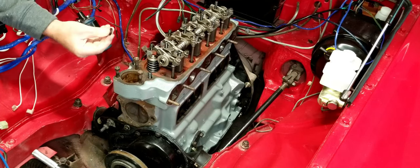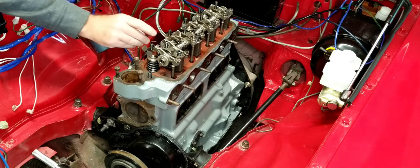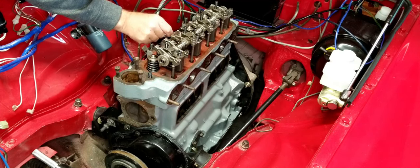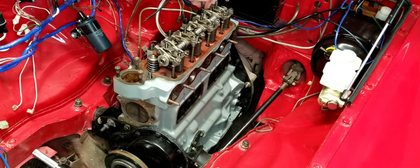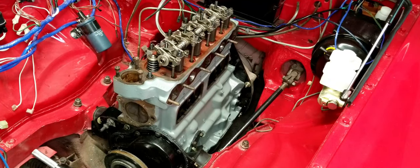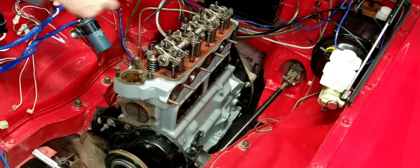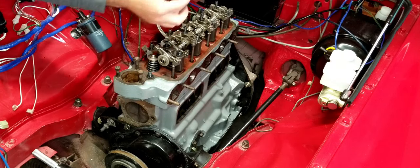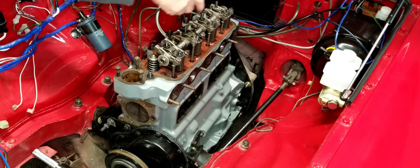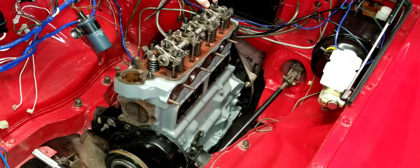All right, so for the head studs, each one gets one of these neat little washers. These are pretty hefty washers, but they come with the kit. Very thick, open holes, and remarkably, no missing parts. Enough to go around. These four that go in the middle have their own little washers, but the last one over here has a special clip that goes on. I was missing one, so I fabricated that, but it keeps this retaining pin, which screws in and holds the shaft steady, from coming undone. So that goes in first, and then the washer goes on top of that.